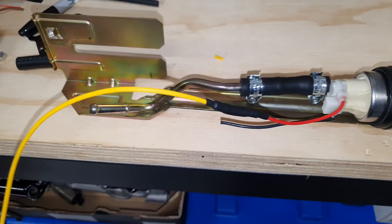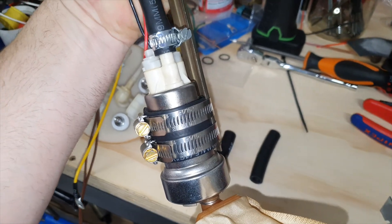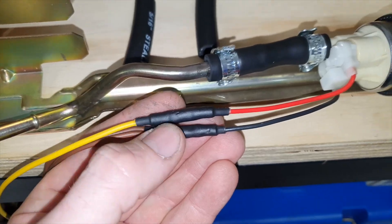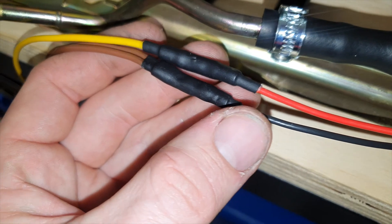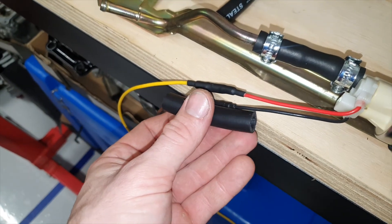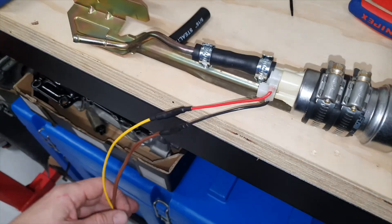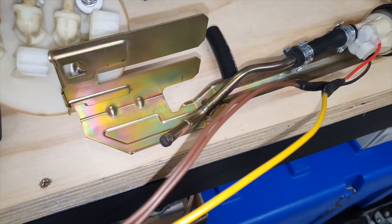When I pulled it out before, the heat shrink had slid off - now we've got a crimp connection with double shielding. I've gone to the extra effort of putting two clamps to secure the pump with some E85 compatible fuel hose. I've used crimp connectors with heat shrink on the inside of the crimp as well. The double-walled heat shrink apparently is not ideal but I've put another layer on anyway, and then I've cut some fuel hose to slide over both individual wires and secure it with metal wire to the actual hanger - there's no way that's going to rub through.